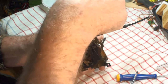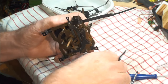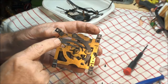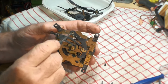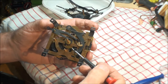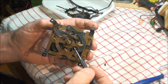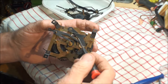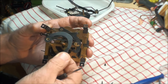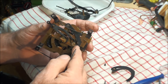Like I say, your pictures will give you the ballpark of where you need to set these things. This don't have much movement at all anyway. But it's there for a reason. Took a while, but we got it off. Anyway, now we have the spring wire that helps push this down. This here, as we'll call that, the Pac-Man, turns. It will go around and catch the teeth on this part here and slowly move up as that thing's turning with the pin until it gets to the end, then it knows when to stop.